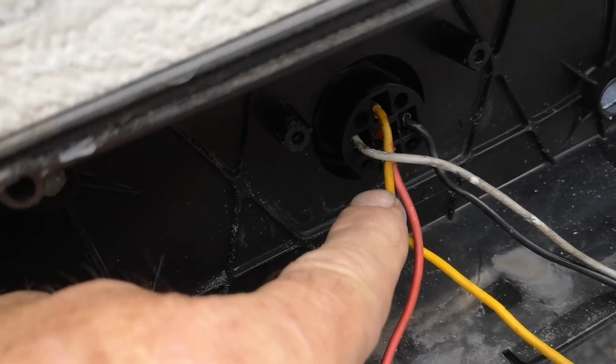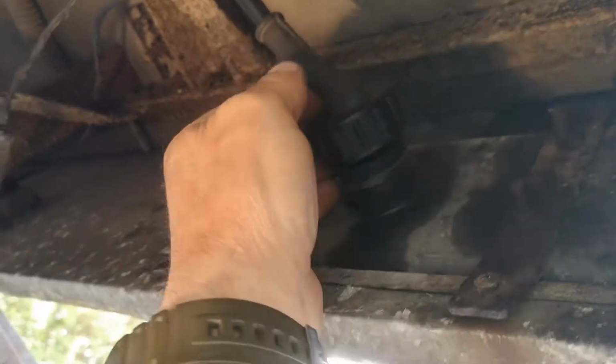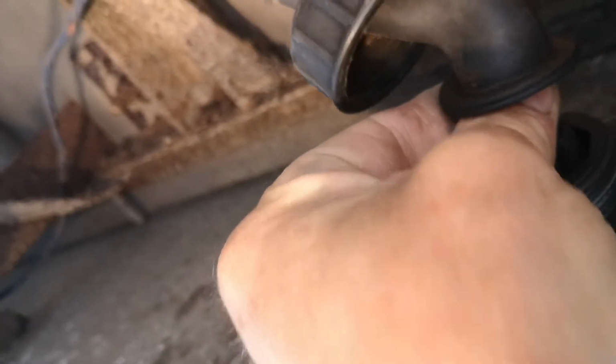Suspicion is that it's in this connector block at the back. This black ground wire, or all the different various wires go through for all the functions and come through to here. Now, I've had this off before, otherwise it wouldn't loosen as easy as this. It was pretty much bunged up with stuff. So that should slide a little bit now just to give access. I think it would be possible to get this on the wrong way around, so you need to pay attention to what colours are in what location, and that plug will pull away.